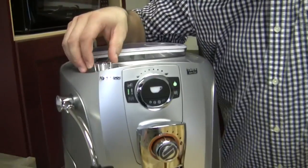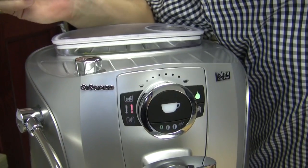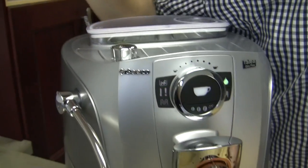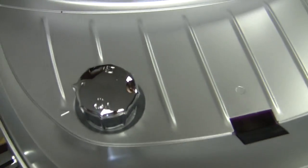But sometimes it's not that simple. You can be getting that air alarm. Let me show you another one. This is a big one that always gets customers. I'm going to partially open the steam knob, and we should get the alarm. There it is. It's just about half a click away, and the valve isn't even open right now. There's a board there and a magnet on the valve as well, and it's just slipping off that board a little bit. A lot of times people think this is actually closed, but it really is just a little bit over.